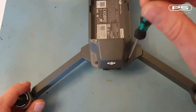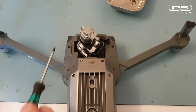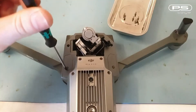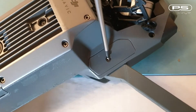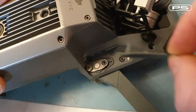Next it's two H5 screws at the back. Not sure why I've got this velcro here but it needs to go. Then we have four screws at the bottom of the craft. The last of the four has some kind of a resin in it and I can't get my tool in unless I remove it — DJI's way of anti-tamper. I can remove these covers now, under which we have the last two screws securing the top body shell.